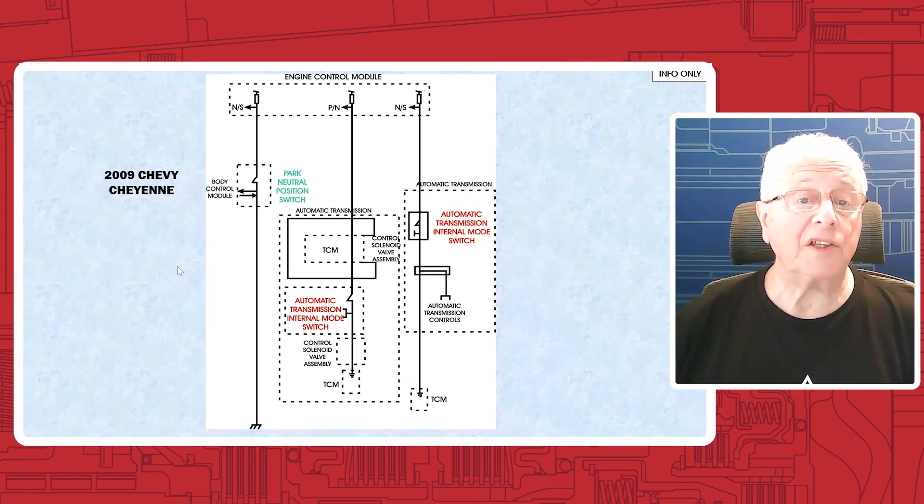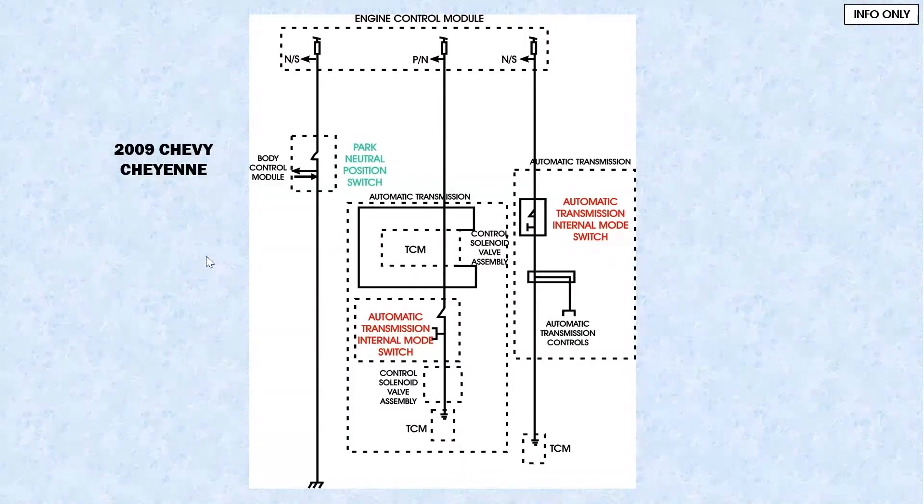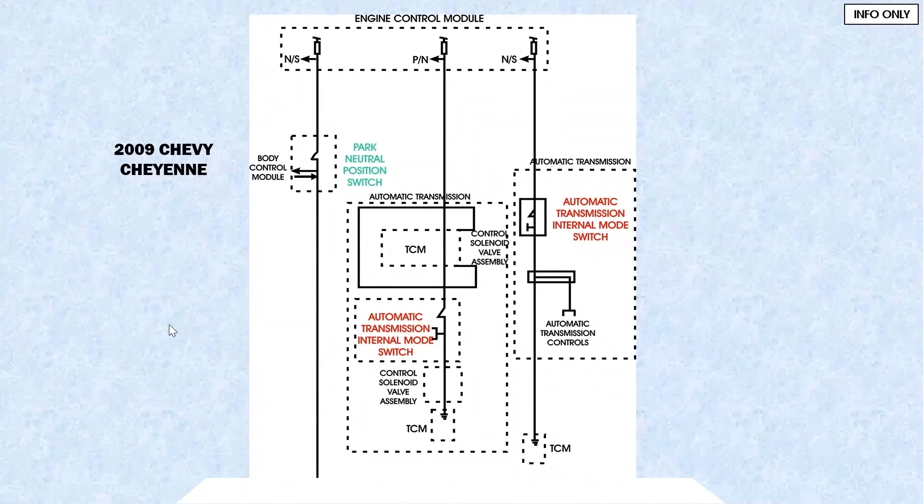For the life of me, I don't know why they did this. But remember, 09 was the first year for the internal mode switch, and there must have been some transitional situations going on that caused them to put both in this unit. When you've got something communicating over the serial data line, you're not really sure what it's actually communicating unless you start tracing down communications and computer data line circuits. It could be for something like pedal position adjustments, or it could be for door locks. I didn't see any reason for it to relate to reverse lamps — that seemed to be on a completely different circuit. Whatever the reason, you may come across this one day and you will, in fact, have both switches.